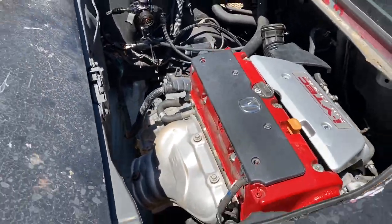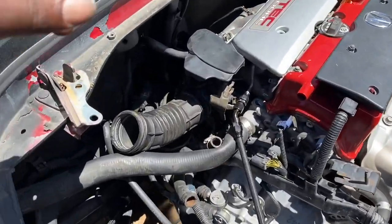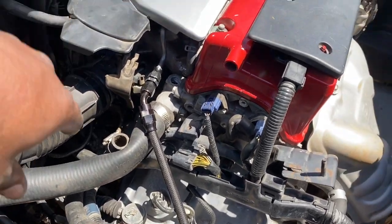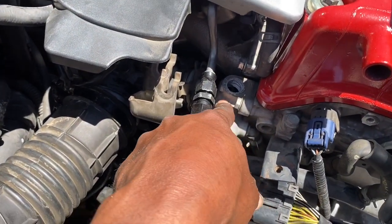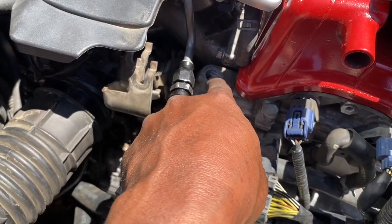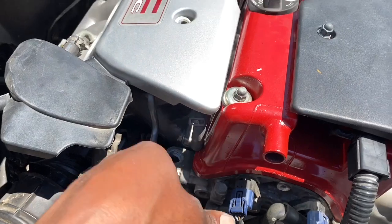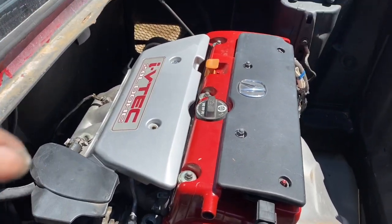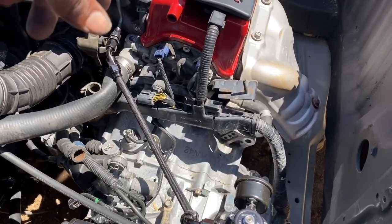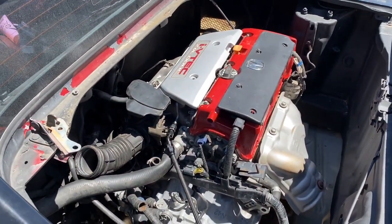But that's most likely all going to be finished on the next video, because I still have to modify the intake, bleed the clutch, and I have to order the radiator cap adapter, so we can put a reserve on here and be able to fill up our radiator fluid. Also need to put on the belt and the throttle cable. But right now, today, we're just gonna get this car started and tie up a couple things, and that'll be it for today. So wait for this battery and then we'll come back.